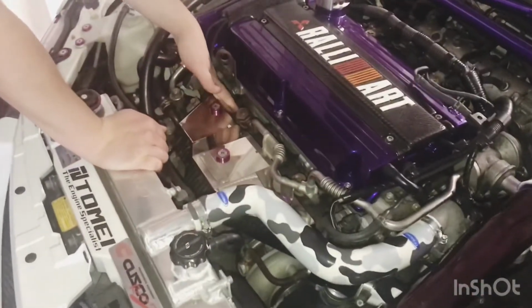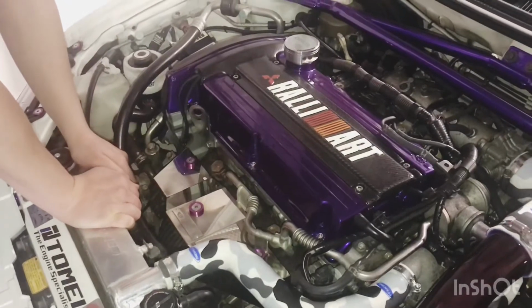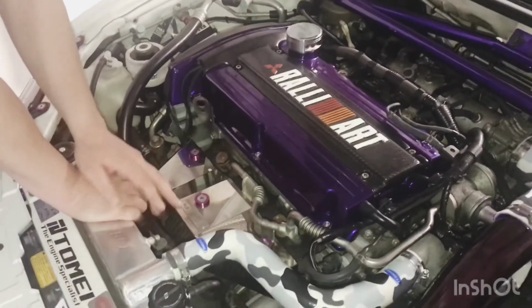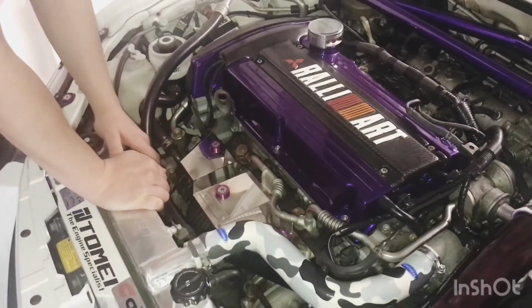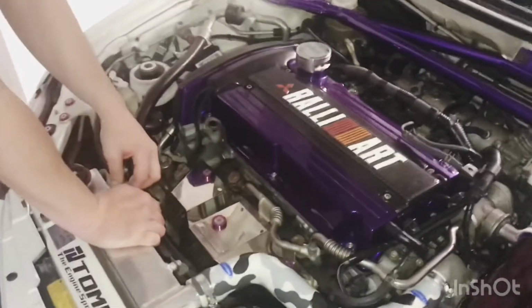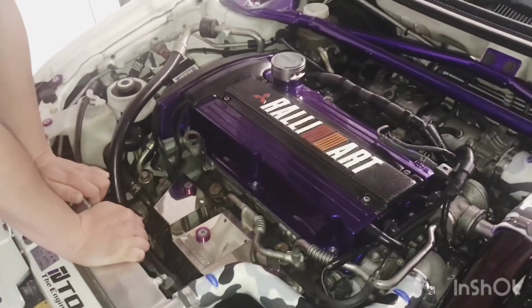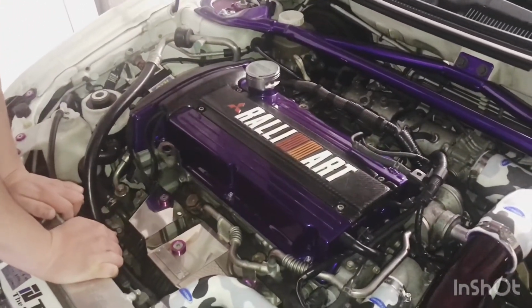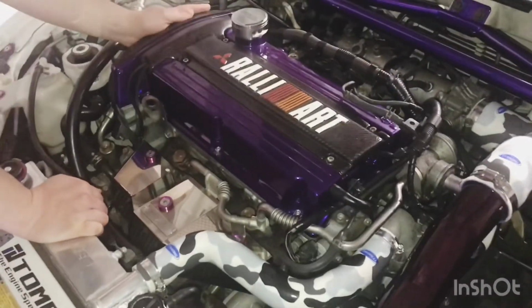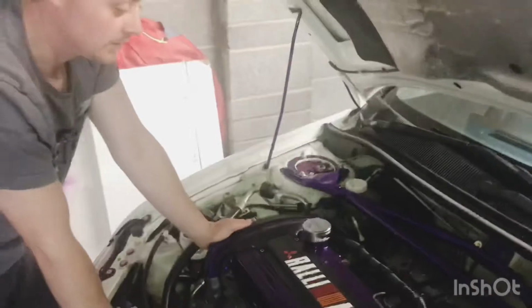We're looking to change the manifold completely. We've already got a turbo elbow to go with that turbo, so we're looking to change the turbo, the manifold, the turbo elbow. Also rods, pistons, as I've explained, full stud kit to keep the head down, uprated head gasket, and I think that's about it, plus a clear cam cover so we can see those pulleys. There's no point having nice shiny parts and you can't see them.